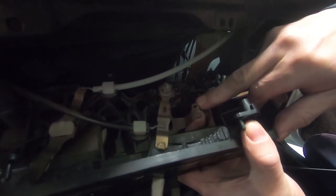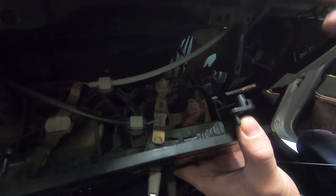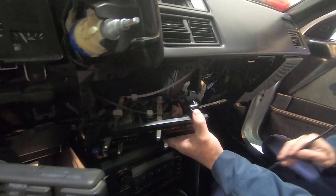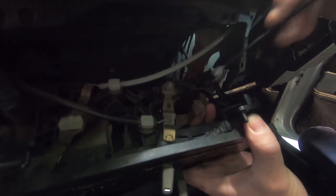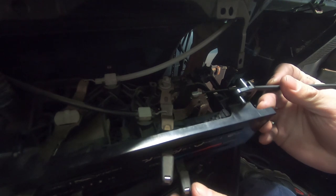This should be for the heater valve in the engine bay, and the forward one should be for the blend door. These need to be drilled out to 5/32nds. I was worried at first because that seems like you're drilling out a lot, but there's plenty of material still left. Let me show you right now — we're going to plug this in. All right, and I'll just kind of demonstrate.